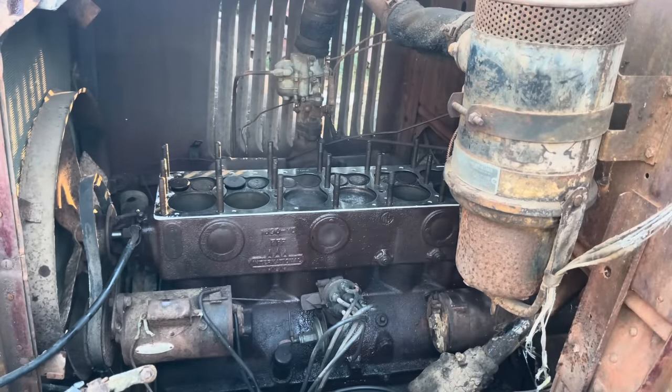Well, we're gonna hook a fuel system up, start her up, and that clutch is probably gonna stick the first time we press it in, and we'll have to do all this over again. But we'll only have to do that three or four times, maybe, and we'll have her on the highway. When we first went, we were messing with this thing, the clutch was stuck to the flywheel like it was engaged, which it wasn't. It was stuck disengaged because at some point someone pressed the clutch in there years ago, and the little forks in there are stuck open.